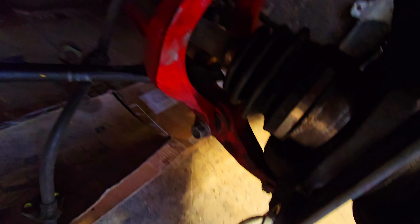Here's the bracket spacer I made. I could grind away and make it cleaner and more flush with the knuckle — I'll do that later. It's on — at least the bracket is. I'm going to spin this. Not touching anything on the bracket. Here's the clearance. Here's the adapter: 1.25 inch spacer. Civic bracket, 96 or 2000 Civic EX. The 10.3 inch front disc or rotor designated for Civics. I'm going to throw the rest of the caliper on with the Civic brake pads. The Accord brake pads will not fit in here because of how all this is set.